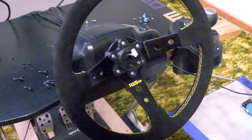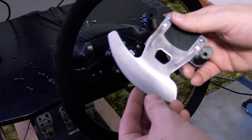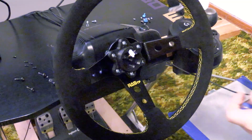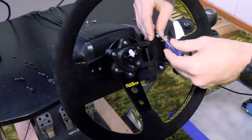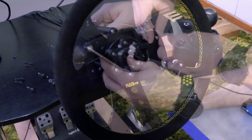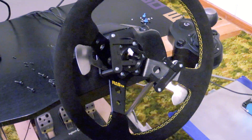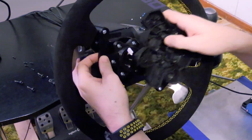Here's what it's going to look like on your paddle shifters — this is the correct way to attach these. It's just an extender so you can still use the paddles; otherwise they're going to be tucked so far behind the wheel that you'll never be able to reach them. They sit back there just like that, then you screw the front plate on, and that front part is what connects to the control center of the wheel and triggers the switch that the original paddle did on its own. Personally I felt this was the trickiest part of the entire build.